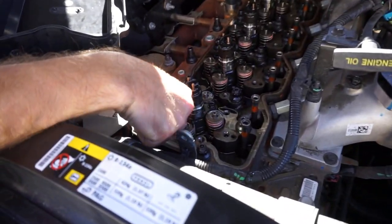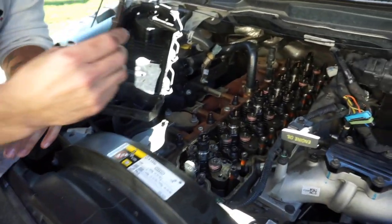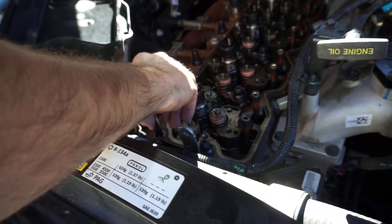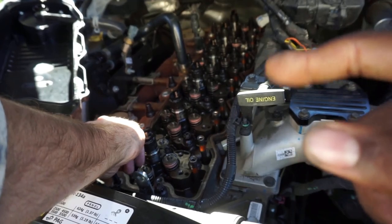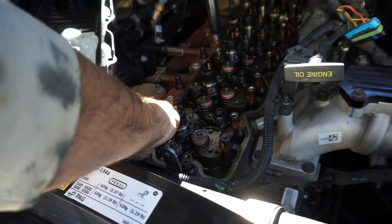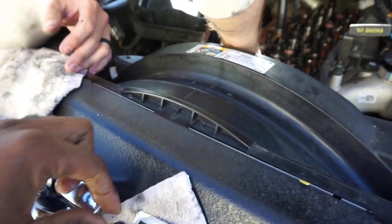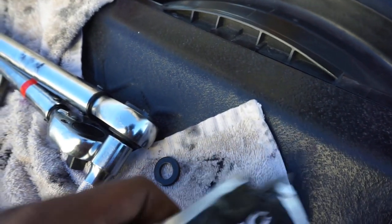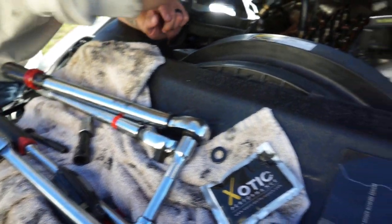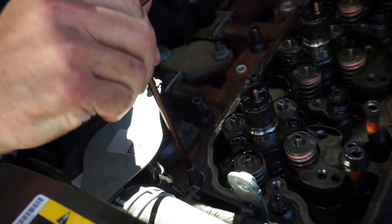After a few beers, a little elbow grease and back work, we are officially on number 26 — the last stud. Ryan's taking out the stock head bolt and going to put the stud in. We already put a little lube on the top-side threads. You don't have to lube the bottom threads — put those in dry. But on the top put a little bit to help that nut when it's time to torque. He's putting in the washer now — coat the washer and the bottom of the nut with some of this performance lube.